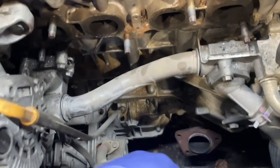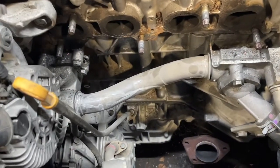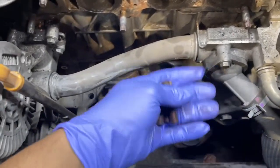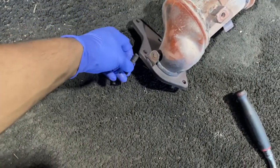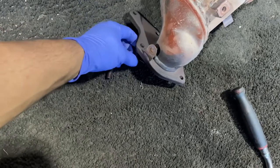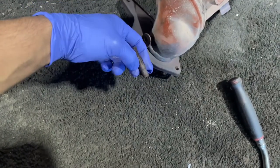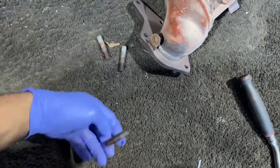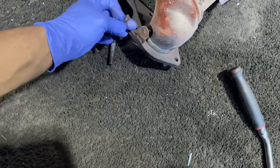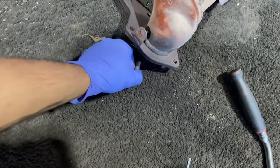Don't forget to remove the old gaskets on the downpipe and on the engine block head - we're going to replace them. They are metal gaskets so some people don't replace them, but if it comes with it or you want to do it right, replace them. Also there are three studs on the old exhaust manifold - they're just screwed in, so back them out. These usually come out pretty easy once you remove the nut. If not, use a pair of vice grips. If you damage them, just replace with bolts of the same thread pattern.